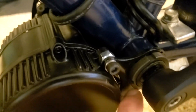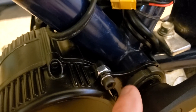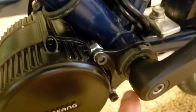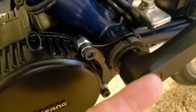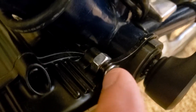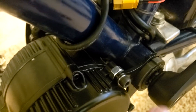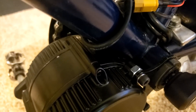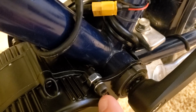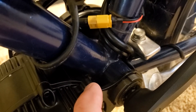This bracket here gets held on by this big nut and is screwed to the motor to hold it in place top and bottom. But if you've got a 73 millimeter bottom bracket it makes it just a little too wide, so the bracket itself is held out away from the edge of the motor mount. There's a space there, and I filled that space with a nut — I just made sure it was a little bigger than the screw so I could slide the screw right through it and bolt it down without bending the bracket in toward the frame.